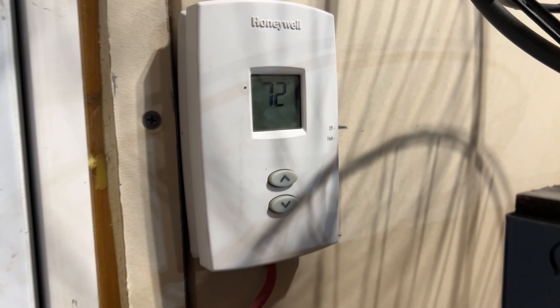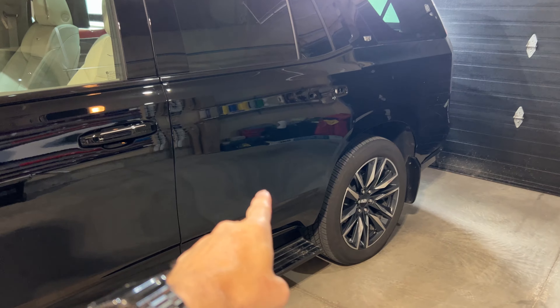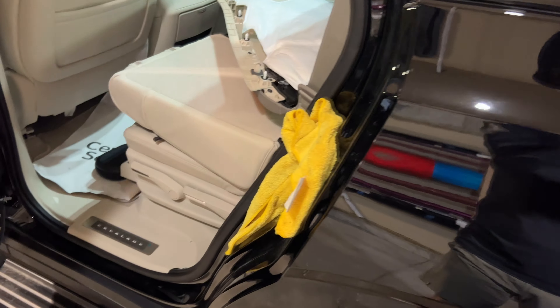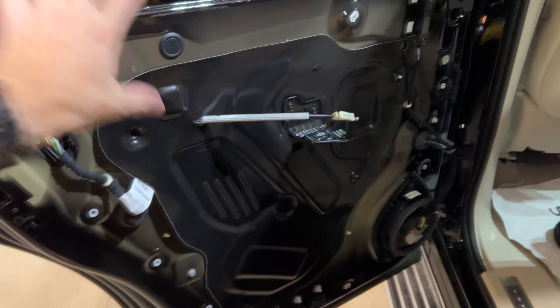Another tip: make sure it's warm enough in the area you're working. I'm going to close the garage door and make sure it's about 70 degrees. You wouldn't really want it any cooler — the vinyl is harder to work with when it's cold. You want it a little warmer so the vinyl expands and can be stretched more easily. You can use a heat gun, but you want to avoid over-stretching, so if the room is warm enough to keep the vinyl relaxed and more pliable, that's what you want.